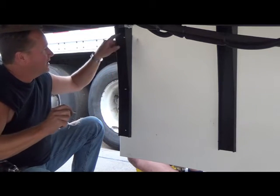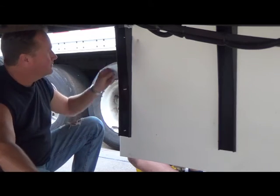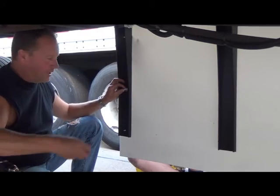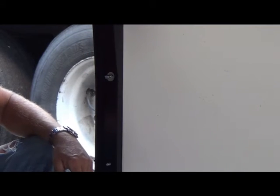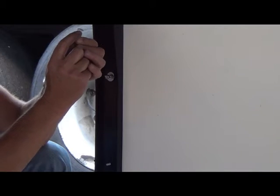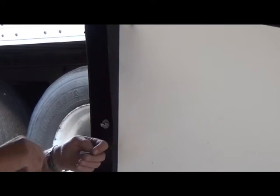He's on the other side and he's pushing these through. And then what we're using is a fender washer, a lock nut, and a regular nut. People ask why we don't use nylon lock nuts, and there's a reason for that. The carriage bolt actually has a square section under the head. And what that does is bite into the plastic round hole and keep them from turning